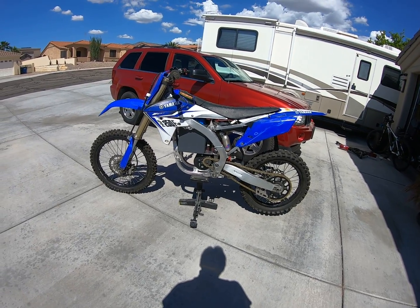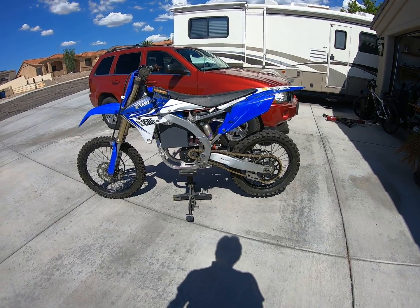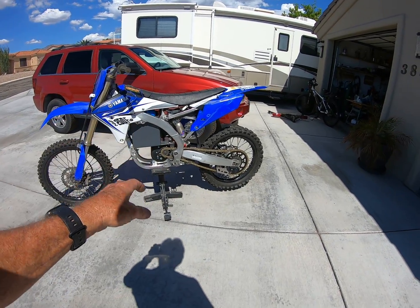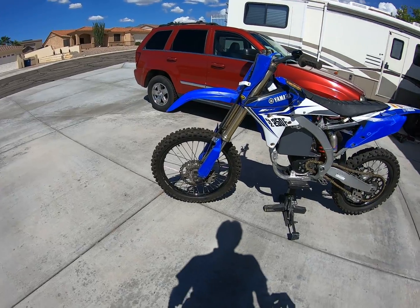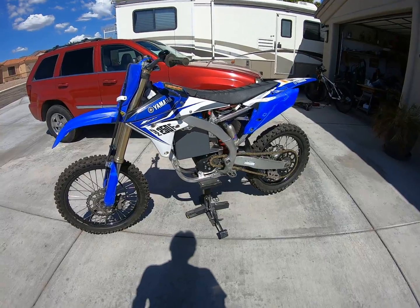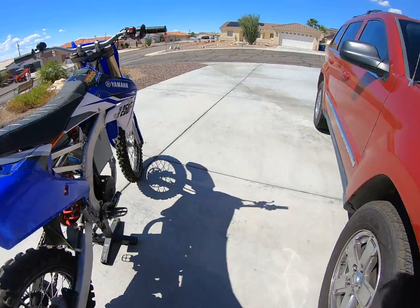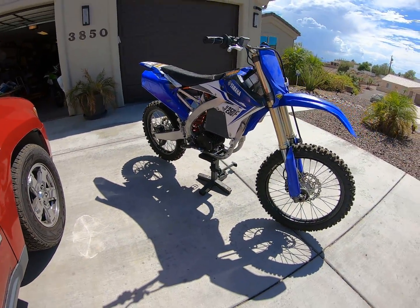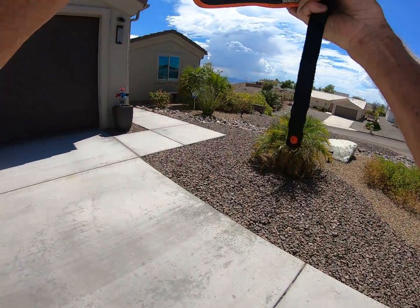This is a 2014 YZ 250F. It's got about a 42 amp-hour battery — the casing isn't finished yet, I've got to make it. It's going to be a quick-change setup eventually so it'll all come out the top. The space below the battery is there, and it will be a pull-out battery. It came out pretty clean. It's a QS 138 motor with an M260 Votol controller. Let's see how she rolls.